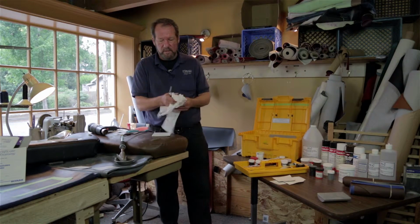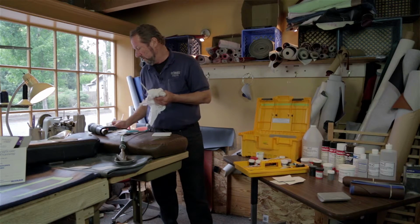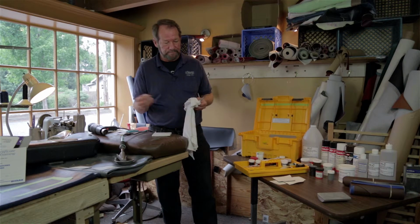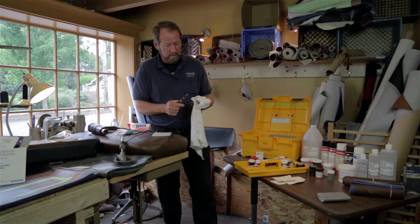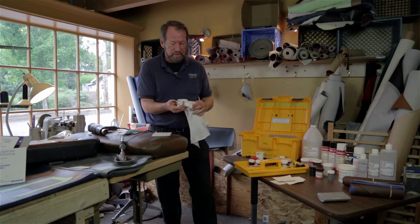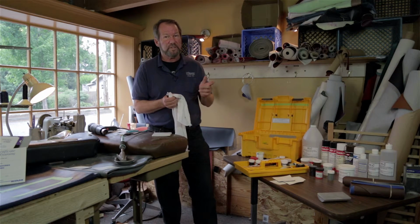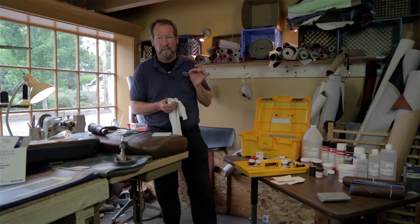I want to emphasize that this particular rubber, although it's the perfect product for graining and texturing, it's silicone. And if you understand about silicone, it's basically your enemy. Silicone film will keep any paint from sticking. It will keep your repair from holding. That is one of the ingredients of Armor All, which I do not recommend. It being just a shine up and appearance product, it actually does not, to my understanding, add any chemical value to the seat cover. It's just an appearance product. If you want something that will benefit the seat other than shining it up, we have other products that are oil-based. That's what you want for vinyl.